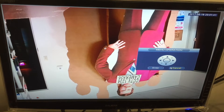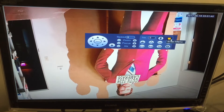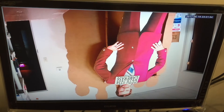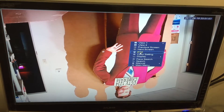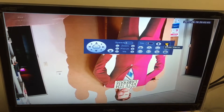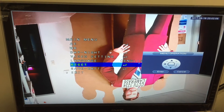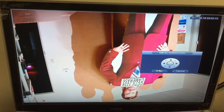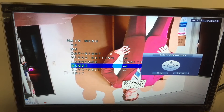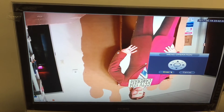If you don't like a setting, go back into the PTZ menu. Right-click, PTZ, expand the menu, enter menu, and then here you can go to reset. Hit enter on there and it will reset the settings. That flash that happened for the menu means it's reset, and then we basically save and exit so it retains the reset settings.